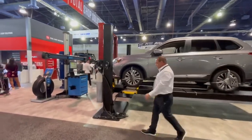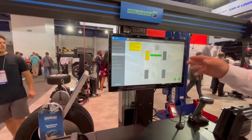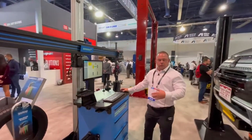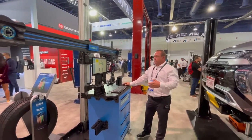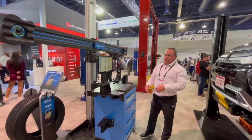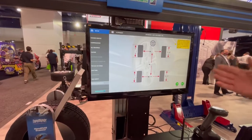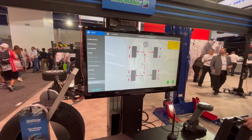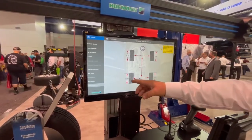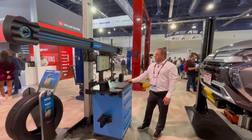From this point, I'll go back up to the front of the vehicle. On this vehicle, it calls for the compensation one alert to be issued. This tells me that there might be a change in suspension in the left front — I can choose to go check out what that issue might be, maybe I didn't do enough of my shakedown and inspection process. But I'm going to skip this. With this machine, we can also set it up as to whether or not we need to do our caster sweep. Another feature is our overall tire diameter — this is part of the compensation one alert. If you're doing an all-wheel drive vehicle, it'll indicate what might be the problem. As we can see, there are overall tire diameter differences. So again, that's part of our compensation one alert feature built into this machine.